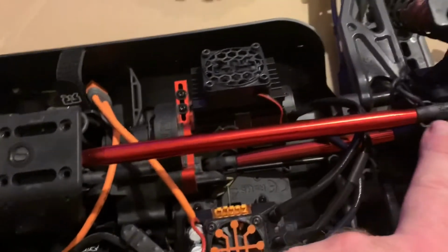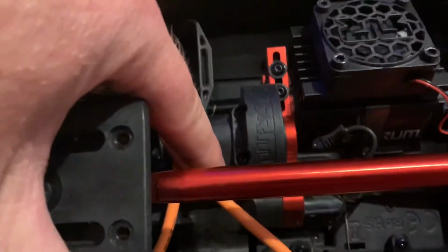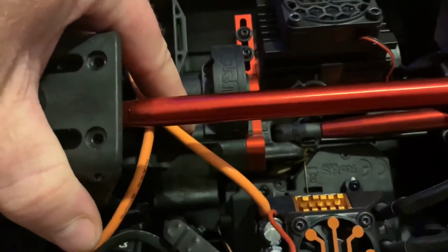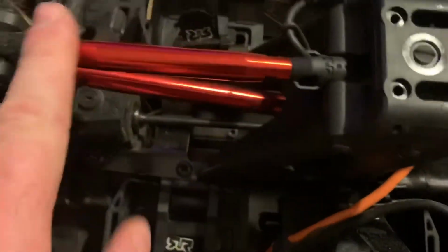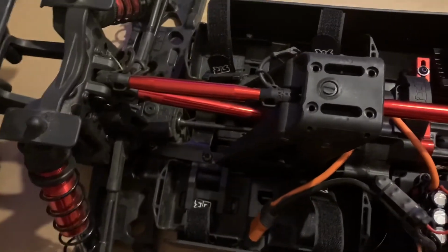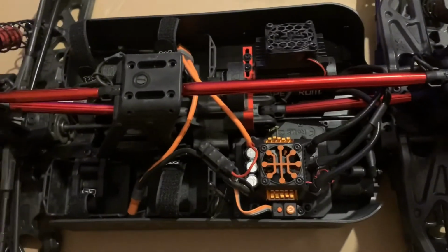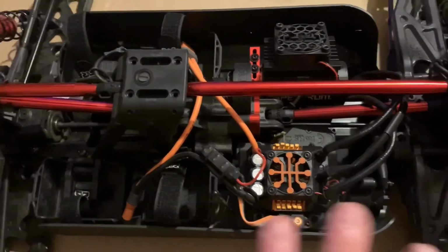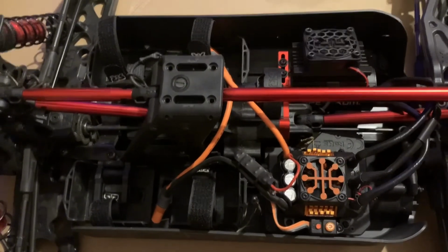Also, checking the shock braces for play, checking the motor mount side here when I swap out the pinion gear, checking the shaft in here to see it's square, checking these two braces, these two mounting points, the body points back here, checking the spoiler and wheelie bar on the back here, flipping it over and inspecting the hinge pins and the flatness of the chassis. That's just the basic go over I do in between my mild bashing and my more hardcore bashing, to see what the damage, if any, is between the two.